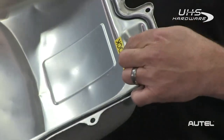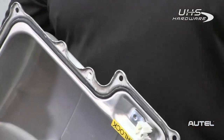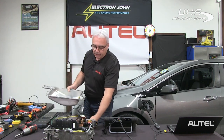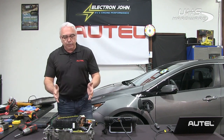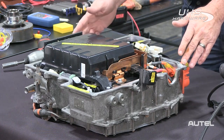If I wanted to do live testing with the cover off — voltage checks or scope checks — I would need to remove the shorting bar and plug it back in. Most importantly, we want to make sure we have our personal protection devices on: high voltage gloves and such if we're going to be measuring live circuits on high voltage. The rest of the cover is just a tin cover, not that important for what we want to discuss.